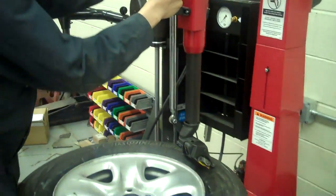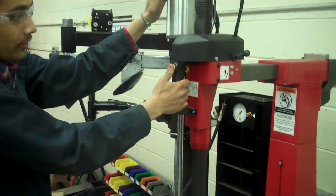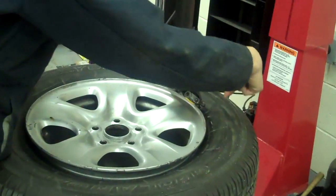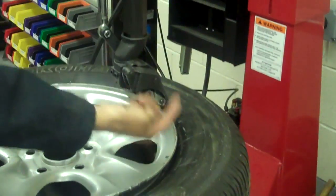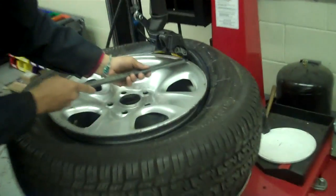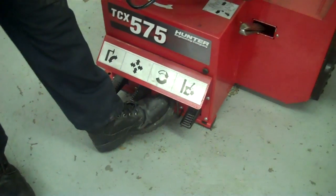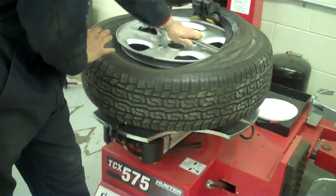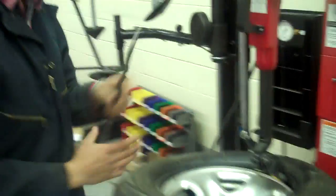I'm going to bring it over the head and take the tire off the rim. I'm going to adjust the head to fit snug against the rim so we can take off the tire and lock it right here. I'm going to flip this switch so the duckbill — I call this part the duckbill — goes underneath the bead at the lip of the tire and pulls it up over the rim. I'm going to take this tire iron and stick it right under here. I'm going to rotate the pedal. Have both hands on the tire iron when you take this off — very important.